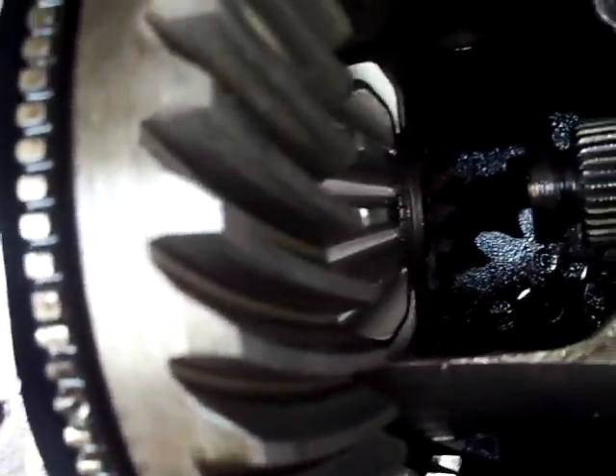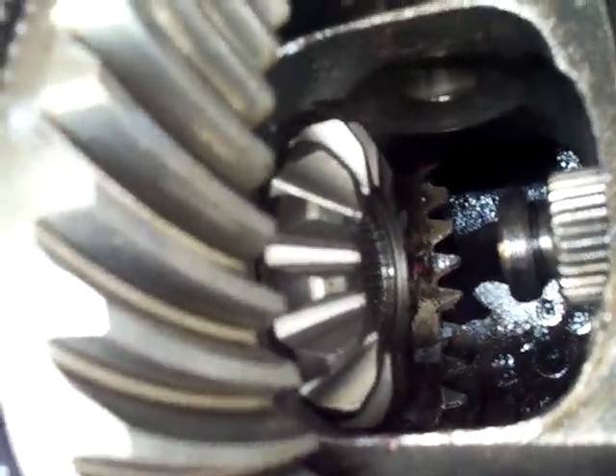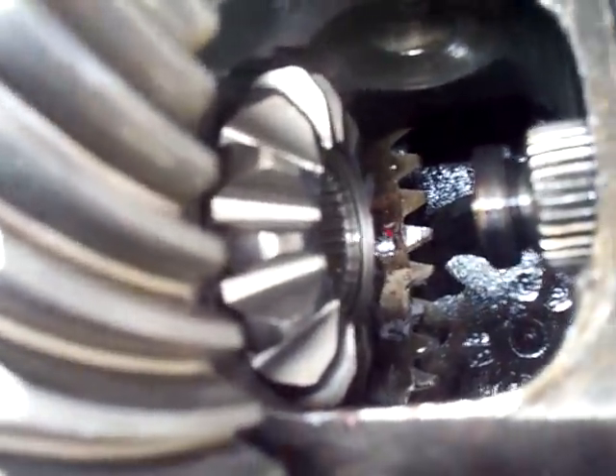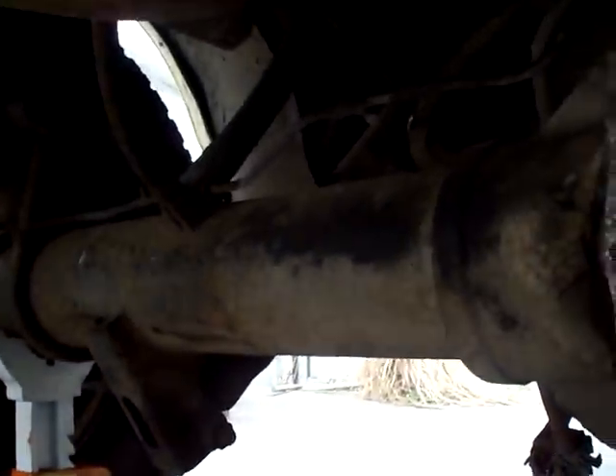The exciter ring clears that ABS sensor. I went ahead and put in the first side gear — I've just pushed back this axle without taking the wheel off. When you remove the C-clip it allows the axle to push back. I pushed it back, slipped the first side gear on. Make sure all the debris is off of it.